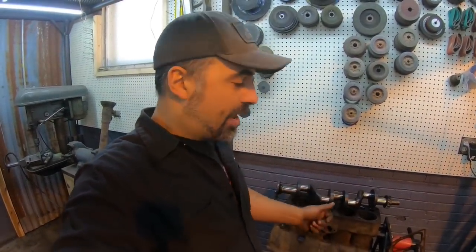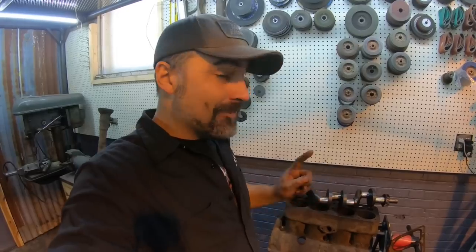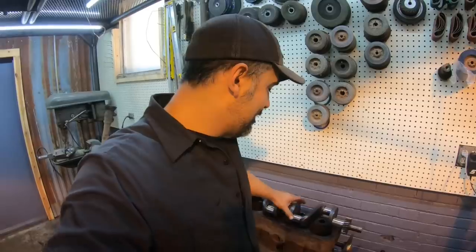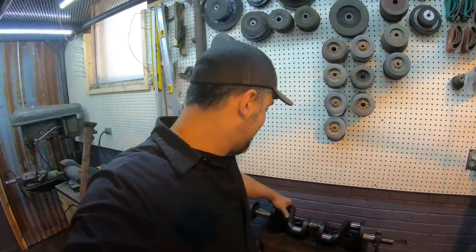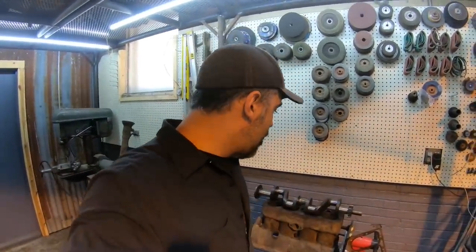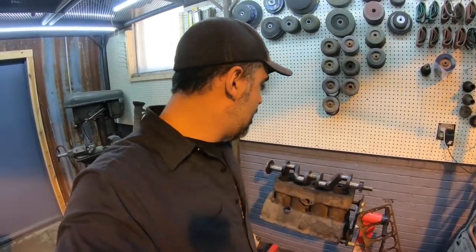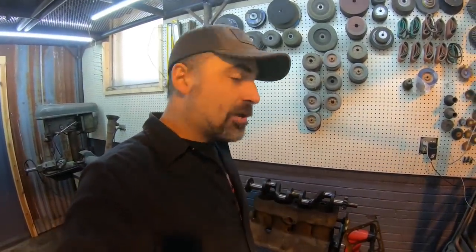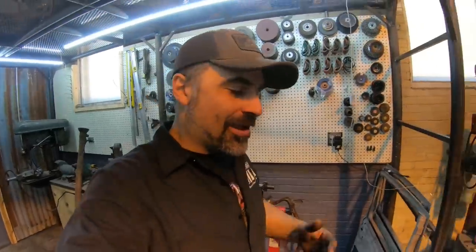If I pull 42 and a half thou out of the cylinder walls on both sides, it should technically clean up. If that gouge is 41, even 42 thou into the cylinder wall, it should clean up with a 4-inch bore in this thing. So that gives me hope. Gives me a little hope, friends. Or we could go 4030. I'd be happy with that too, a 30 over, 4-inch piston 30 over. So I think it's going to clean up without a sleeve. We'll find out. Anyway, like I said, guys, thanks for watching. Till next time.